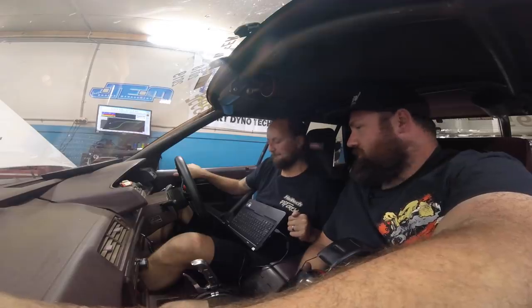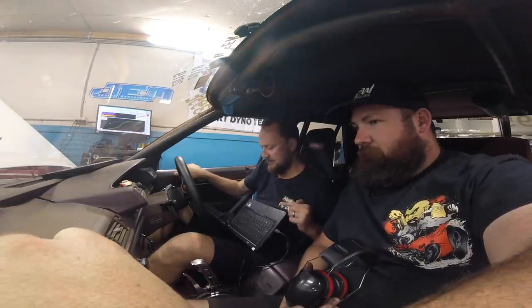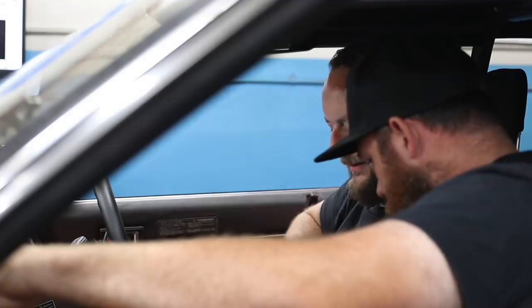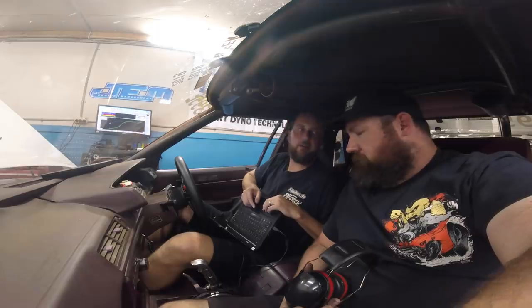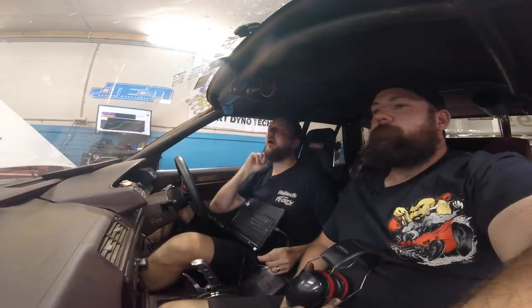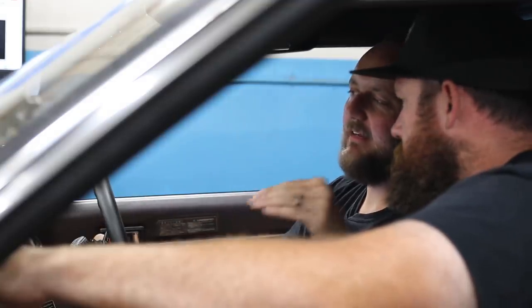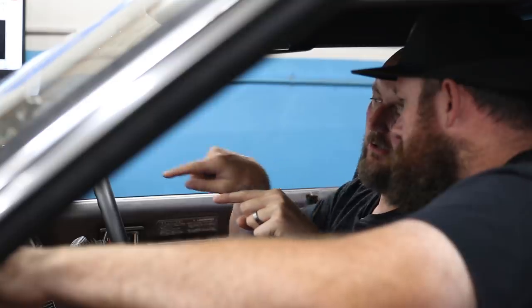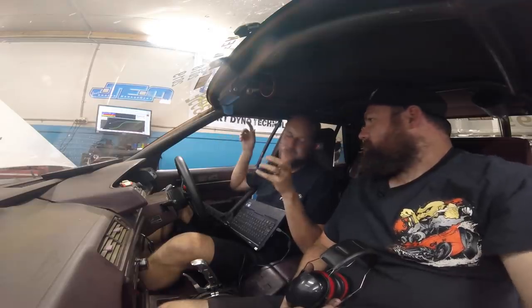So what do you want to do? Just call it done, I think. There's no point trying to break shit — I'm annoyed and we shouldn't be breaking shit. I'm annoyed that we can't wind it up. Need more fuel pressure, need more fuel flow. I reckon what's happening — when you run out of injector, we get a perfect diagonal air fuel ratio line. With experience of ruining a million different fuel systems, when we run out of fuel injector, instead of the air fuel ratio being at our 11.0, we run a perfectly diagonal line as we increase revs or load. AFR just climbs — that tells me that we're out of injector.